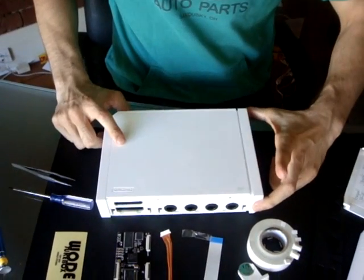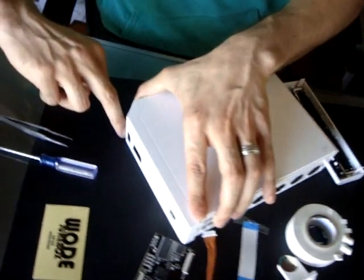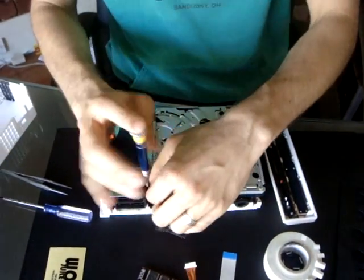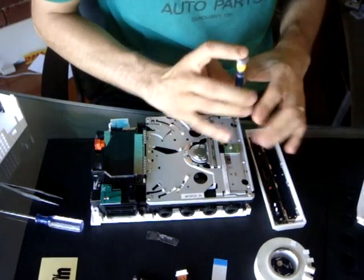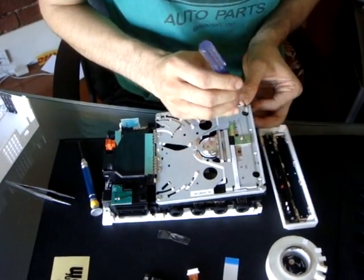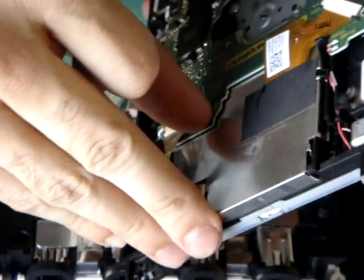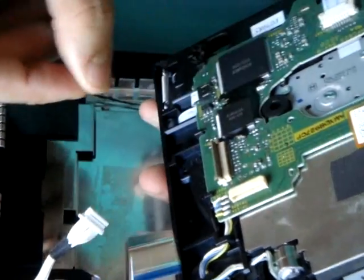Pull this gently off and let it drop. Some people like to disconnect it — I don't see a point, you can just leave it there. Put your fingernail on the bottom part of the wheel and just lift up. There are four screws holding down the DVD drive. Lift up your DVD drive about two centimeters, slide to the right, this little bit will pop out, then turn it around — that's your exposed DVD drive. With your nails, take the power cable off and gently lift this bit up. Leave your thumb on it while lifting so you don't pull too hard and rip it off.